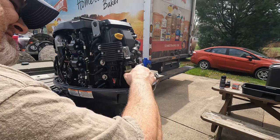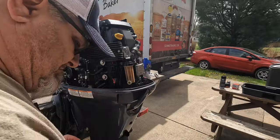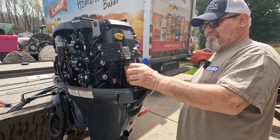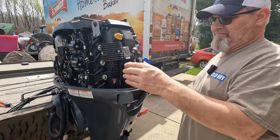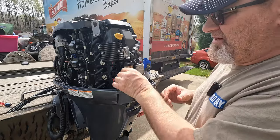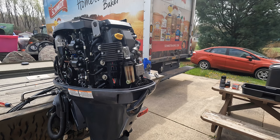Pops in. That's the fuel filter — that's how easy that was. Unscrew it, take the little filter out, put the new filter in, and done. Got the fuel filter done, got the oil done.